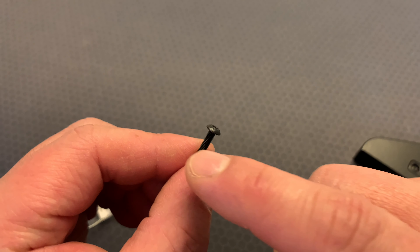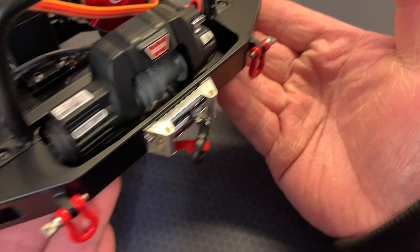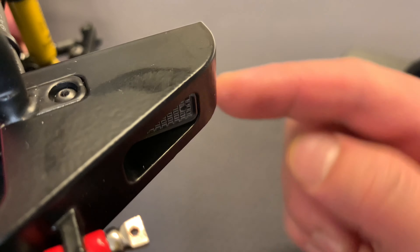Here is the product code and here are the dimensions. When you screw the bumper in, don't forget to use some blue Loctite on these screws. Once your bumper is mounted to the chassis, it's now time to install your electronics and also the winch.